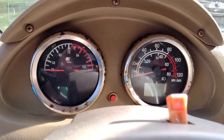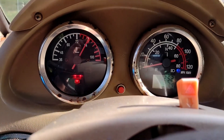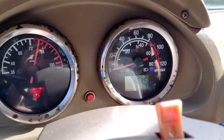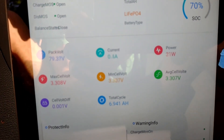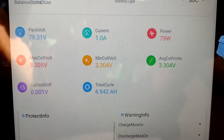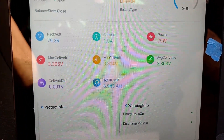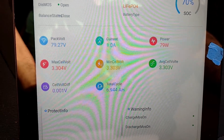When I turn this on, there is a disconnect down here. I'm going to turn the key — bam. There's the mileage: 1252. Brake lights on. Right now it's drawing about 23 watts. When I turn this on you'll hear the solenoid turn on — click. Now we're pulling 80 watts. Just sitting here in forward, it's pulling like an amp, which I don't like. I'm going to have to figure out what's going on there and see if I can make that a little more efficient.